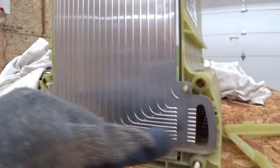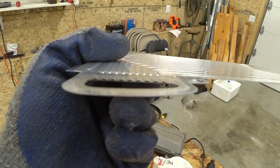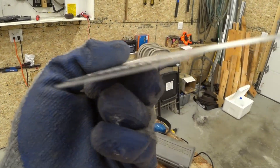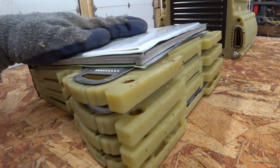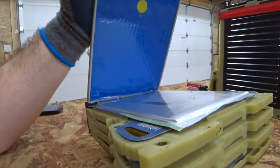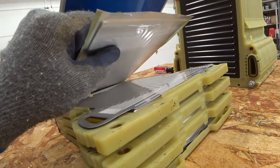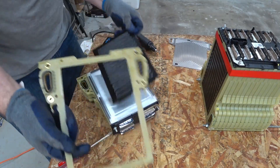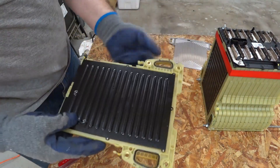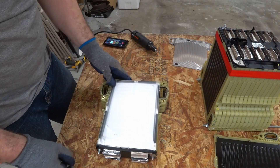On this side, this is where the coolant flows — it actually flows up and over this plate. Look at how tiny those fins and tubes are. There appears to be air in the top and bottom coolant channels. We got the steel plate off — I might be able to reuse this for the other side. Then we have a piece of plastic with double-sided tape attached to the pouch.